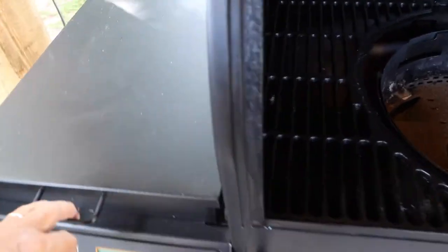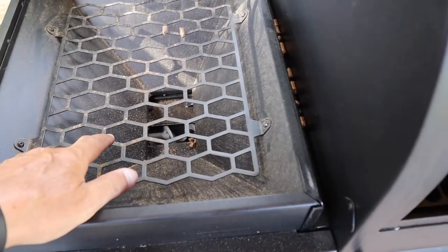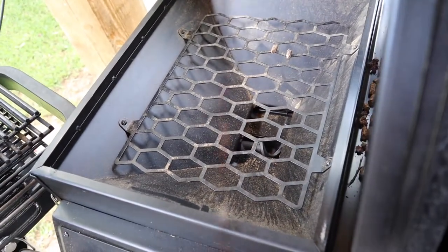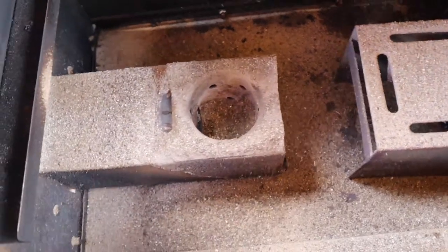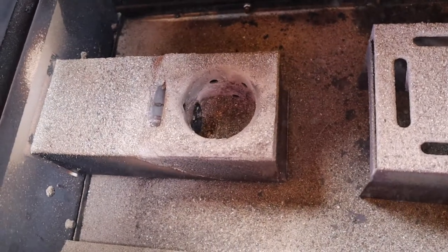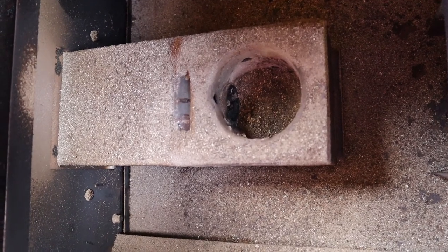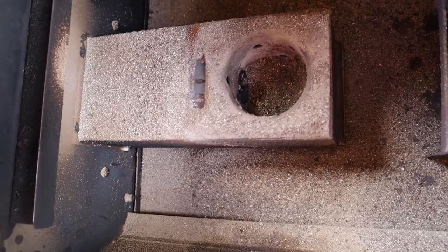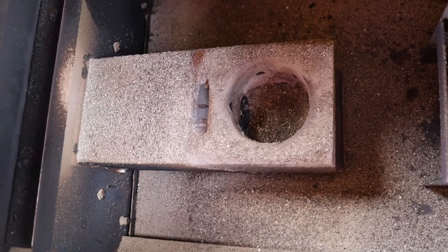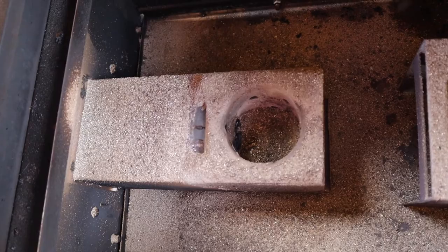That's one of the benefits of the Oklahoma Joe's — because of the pellet dump, I don't get a buildup since there are no pellets left in the hopper or in the auger. The last thing we want to do is check our igniter. I'm going to turn this one on — you can see the fan is blowing. Very shortly that igniter down there should start getting red hot; if it does, that's a good sign and we know it'll catch things on fire. But sometimes it won't, and in that case we might have to replace our igniter — it's probably one of the easiest things there is to replace.